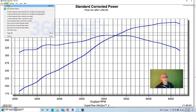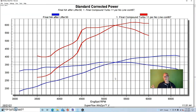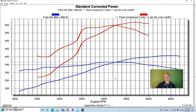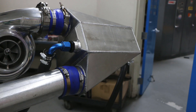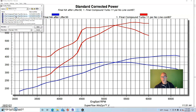After we installed our compound turbo setup, we started out at 11 pounds of boost. The power curves were a little jagged, probably a function of boost control. We had two turbos: a 76mm from CX Racing and an S480 billet wheel T4 turbo from Borg Warner — mostly because those were turbos we had laying around. One early issue was the thing wouldn't make any boost until I routed all exhaust from the wastegates of the primary turbo back in to feed the bigger turbo. After that, things worked out much better. We ran this through an air-to-water intercooler from Pro Charger with ambient dyno water.